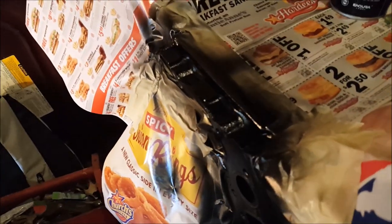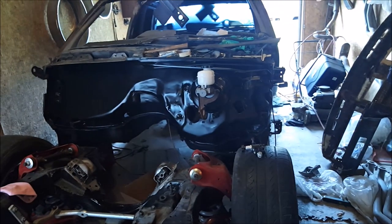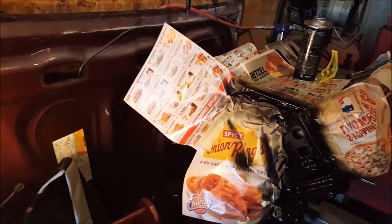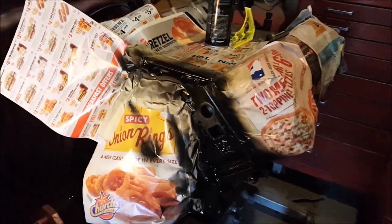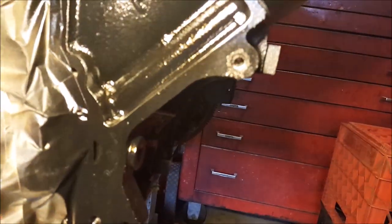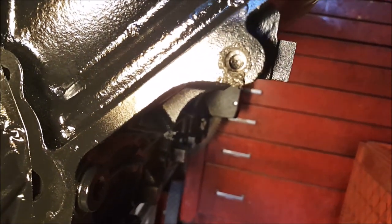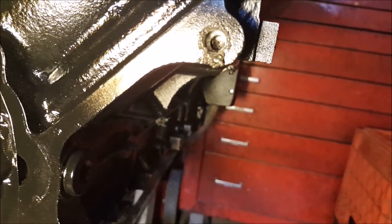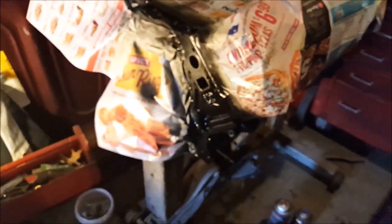The clear gave it a little gloss but it's not super glossy - it's a low gloss, which should match with the engine bay pretty decently and look clean when I'm finished. Right now I'm drilling this hole for the alternator bracket. Truck blocks do not come with that hole, so if you want to run the LS1 front-end accessories you have to drill it to run that lower alternator.